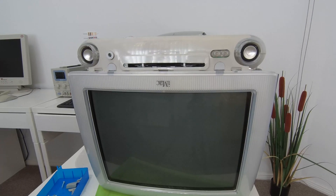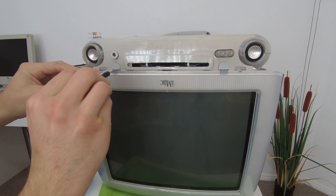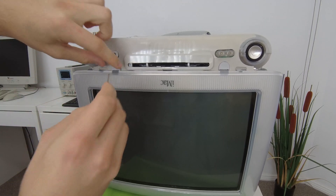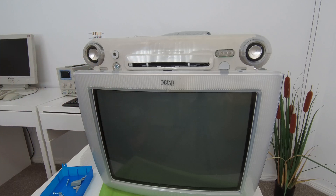Now that we've pulled off the back cover, we can locate the two hidden screws on the front of the iMac. These are located under slightly discolored plastic flaps on my unit. Take a small screwdriver, stick it underneath, and then slowly pry it out. That way you will not break any of these plastic pieces off.